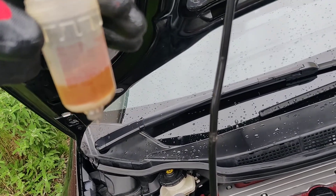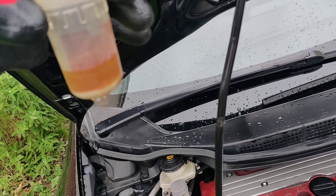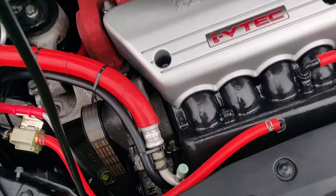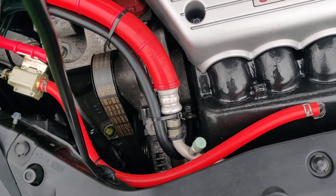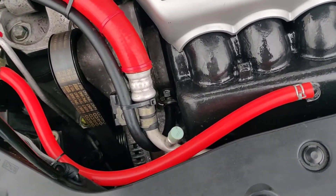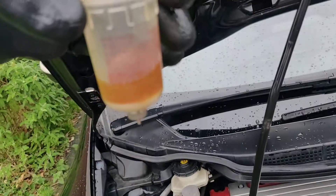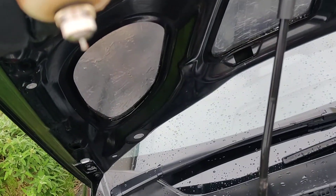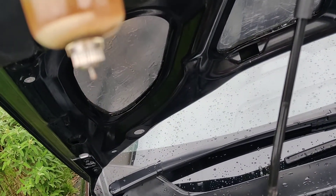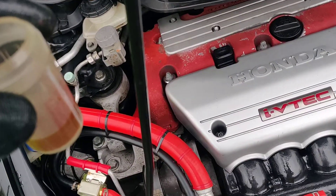And if you imagine this is going into your air intake, it's quite a lot of oil. I would definitely recommend getting an oil catch can, just a little one like this or a bigger one, whichever is easy for you, and putting it in line with the PCV valve. Because looking at that after 500 miles, that is a lot of oil. I don't know what that white misting is — looks like moisture — so definitely don't want that going into your engine or your intake.